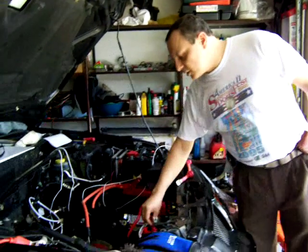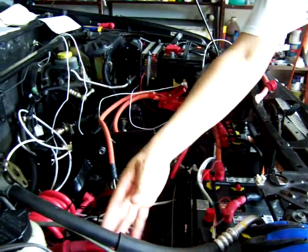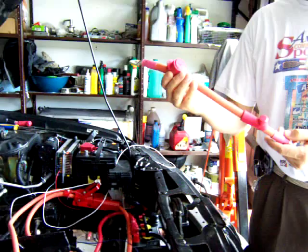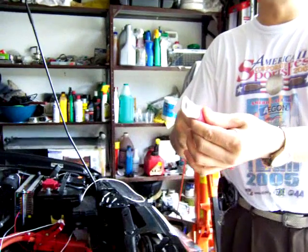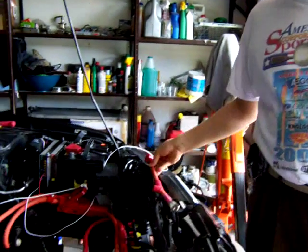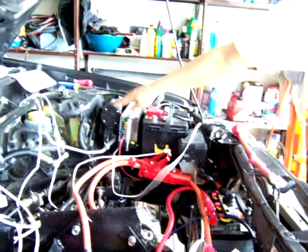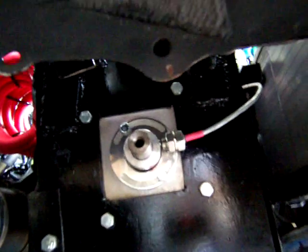I've been installing cables and covers. As you can see, the batteries in the bottom already have all the cables and the covering, getting ready for the batteries on the top to connect them. I ordered several cables from a local battery supply person who can make these cables at a decent rate, so I have all the cables I need now. I've been installing the reverse cable, all the cables for the vacuum pump, the DC-DC converter, and all the cables for the proximity sensor. The proximity sensor is installed now and the cable goes all the way to the controller.